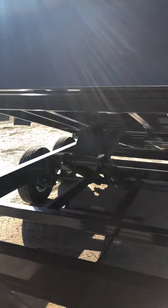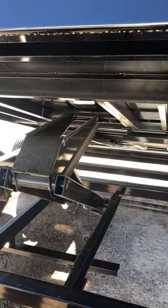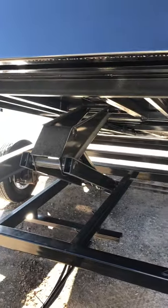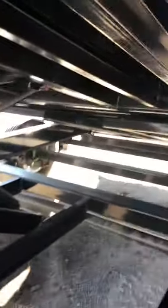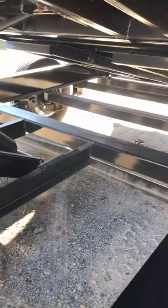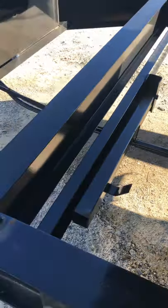People always ask what's better — what's the difference? To me, a scissor lift is better because it's picking up from the heaviest point of where your weight would be on the trailer. For a dual cylinder, you're going to have a post here and a post there, so nothing is lifting from the center of that trailer. The scissor lift is grabbing from where your heaviest load is always supposed to be — centered over the axles. That's where this is lifting from. So the scissor lift is the way to go. You can also see the slide-out ramps underneath here as well. Everything's nice and clean up underneath. Manufacturing is fantastic on these trailers — PJ is a huge, well-known, and well-respected manufacturer. You have a safety bar there, and they're just a fantastic trailer.